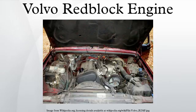It is also recommended to replace the crank and camshaft seals at every interval and to thoroughly inspect the tensioner and idler pulleys for wear. Volvo Penta sold the OHC Red Blocks as marine engines as well, just like the older OHV engines. Depending on the model, the displacement was 2127, 2316, or 2490 cc. The engines with 2490 cc displacement, identified as the Volvo Penta AQ151 and AQ171 models, got a forged crankshaft with a longer stroke together with pistons with a 3 mm lower compression height. The 2490 cc blocks still had B230 cast in the block. Penta used both the 8-valve and 16-valve cylinder heads, and the 16V versions didn't use the different block like the automotive B2X4 with balance shafts.